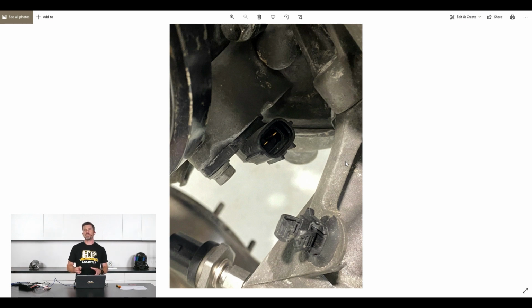Yeah, I would recommend doing this at the ECU header plug, because if we do it at the engine, which we absolutely could, we're going to need to basically extend our wiring for our oscilloscope probes out into the engine bay. Generally, we might have a situation as well where our engine speed position sensors or our cam position sensors are not located physically right next to each other on the engine. But if we do this at the ECU header plug, we're only talking about small distances.